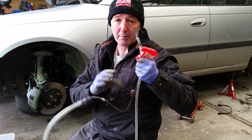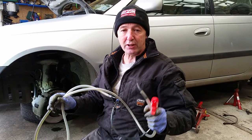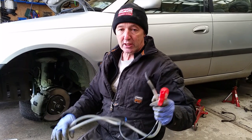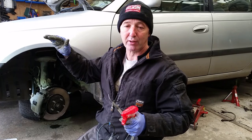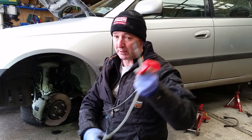So that's it — it took a couple of minutes, if that. It's very easy. You don't need somebody to hop into the car and pump the brake pedal and then release it — it's done. The brake reservoir is higher than the wheel arch, so if you pump it up as high as the brake reservoir, you've already purged the line of any air that could be in it. Couldn't be easier.